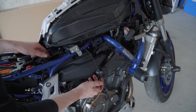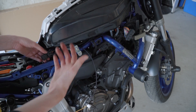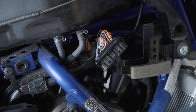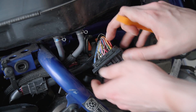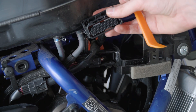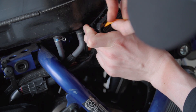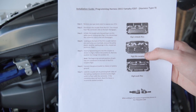With this connector it's just going to sit right here, so if I want to make changes to the tune or to the ECU, I won't have to take off this panel — all I have to do is just take off the seat and plug it in here. In order to put these wires into this connector you actually have to look inside. As you can see right here there are two tabs up top — don't push them in but push them downwards. There's one and there's two, and now these pins are unlocked.